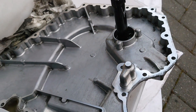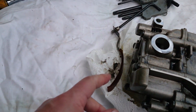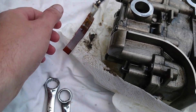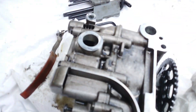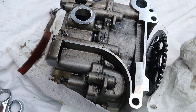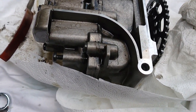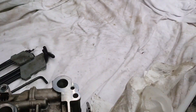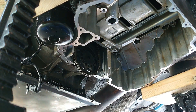I've cleaned up the bottom pan — that's all nice and clean. I've got the oil pump to go in. I've also removed the chain tensioner for the oil pump to double-check it — that looks okay. So we'll go underneath the car, get the oil pump back in, put the chain tensioner on, put the pickup tube, put the gasket on, and get this thing on as well. And then I think that's it — oil tight. Just got a few bits to connect underneath. Let's go.